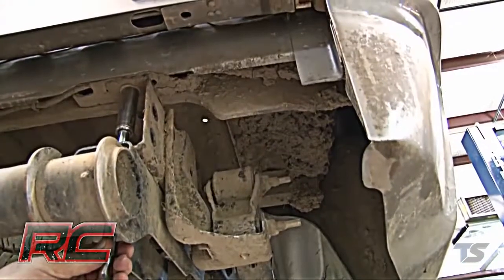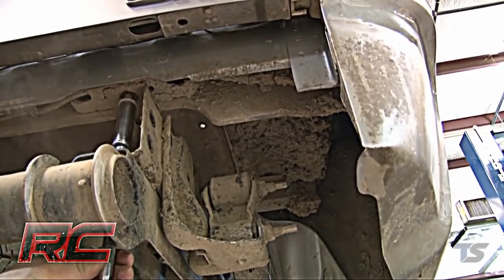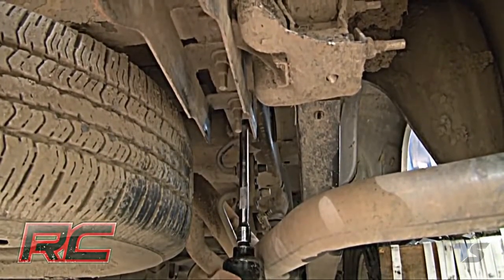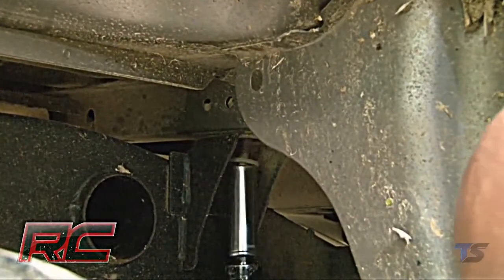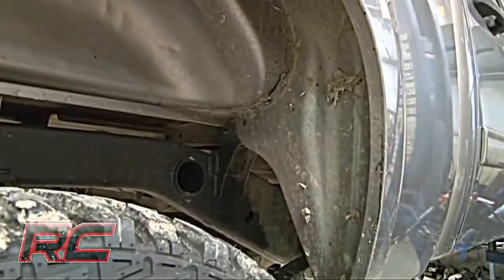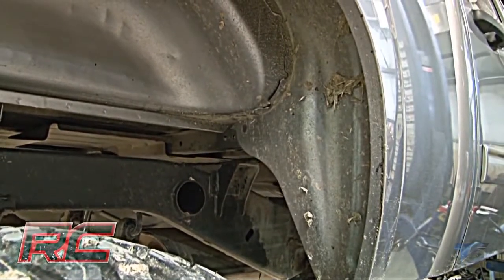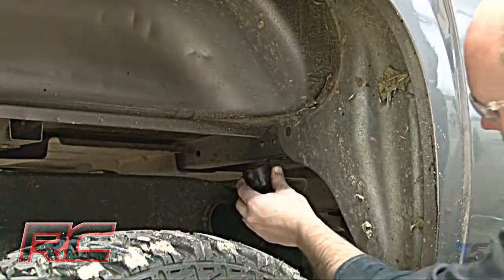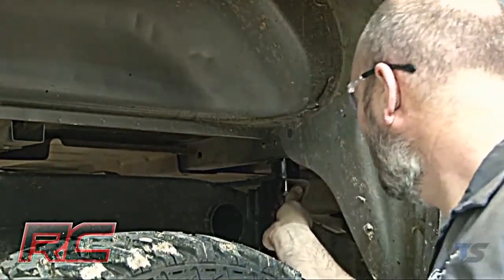Loosen the 6 bed bolts, but only remove one side at a time. With a jack stand or hydraulic jack and wood block, raise the passenger side slowly. Raise the bed up enough to install body spacers. Install 4 body spacers per side and add Loctite on all the supplied bolts and washers.